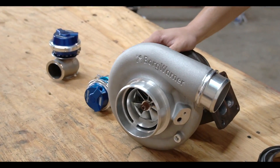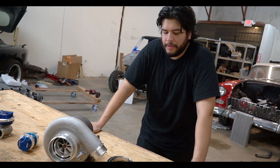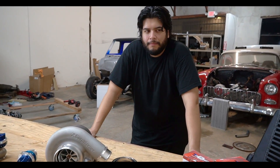We're going to run the intercooler piping to the intercooler up front. Oiling is the biggest concern people have when running the turbo down low, but with a good oil pump — we're using a Turbo Works oil pump — you don't have much to worry about. The whole reason we're putting it down there is because it's not a permanent deal.